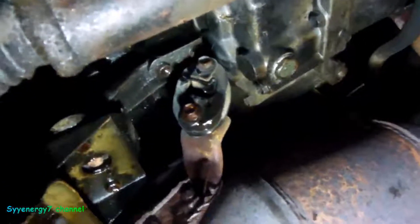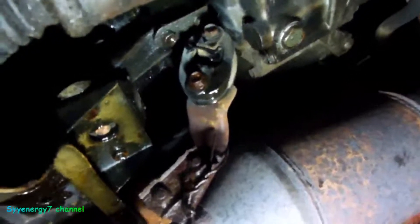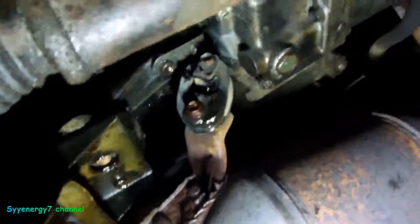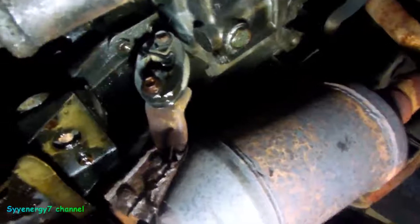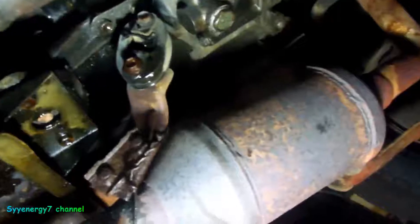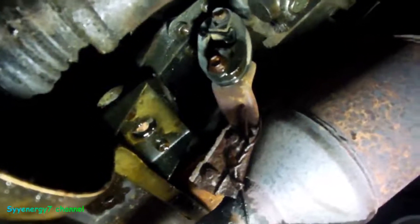It wasn't really a major problem - mainly during that 120-mile trip this thing was leaking. Since this is a rebuilt transmission and rebuilt transfer case with very low mileage on them, the seals are new but they've been sitting a while in one position - that's probably why they're leaking a little bit, not because they're worn or dried out. I'm going to try the AT-205 for the trans and transfer case, but for the differential that's the original seal so I'm going to change that. If the AT-205 totally eliminates the leaks I won't bother changing those seals, but I'll keep them on hand just in case.